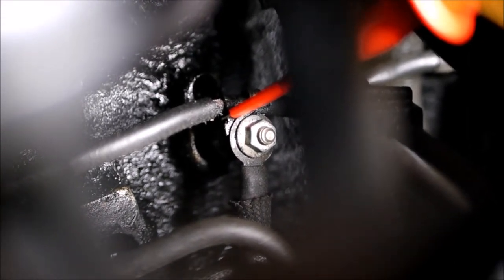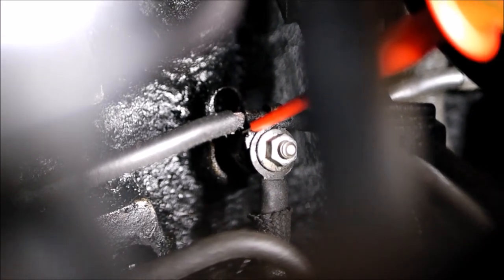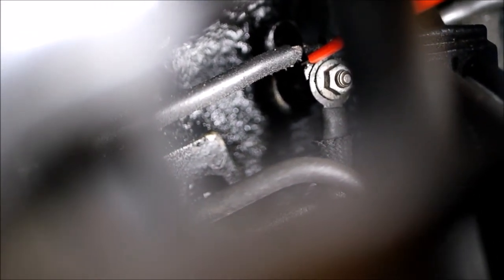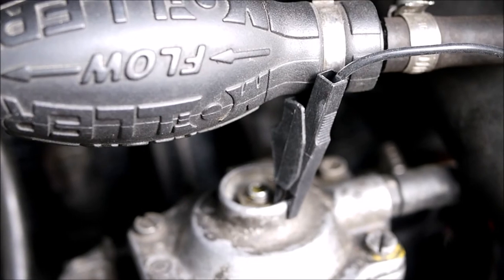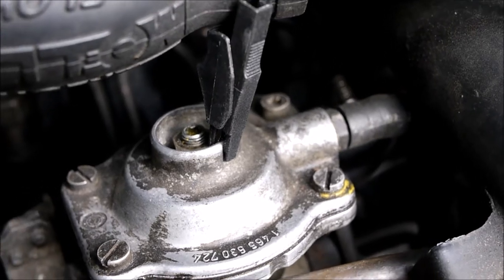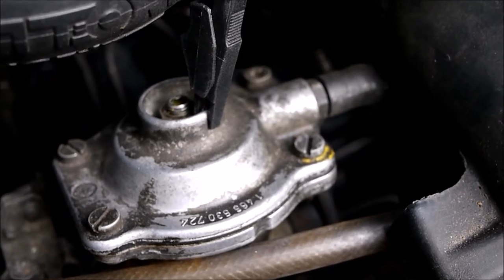And as you can see in there, guys, the probe of the meter is latched round the third glow plug in, which is where at the bottom of the thing here. I can't exactly point to it with the camera, but the bottom cable here, you see the sleeve moving there, that's where the relay attaches to, and the live probe of the meter is attached to the glow plug. And I'm going to measure between that and earth, and as you can see here, the earth of my meter is simply grounded on top of the injection pump. So I'm going to flick the ignition on now, and I'm going to bring the glow plugs on. Remember, of course, when you're testing it, you will have to test it within 10 to 15 seconds, and it should bring the glow plugs on, and you should see 12 volts on your meter.